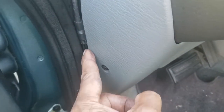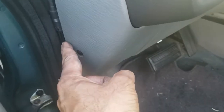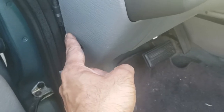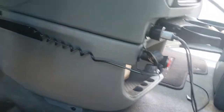The connector splits into two — one of them is power. They did also include a pigtail that you could run straight to your reverse lights, but the pigtail is only about five feet long, so I would have to splice another wire in to get it all the way back to the reverse lights. Instead, they also provided a cigarette outlet adapter, and with that I ran the wire under here and hooked it underneath.